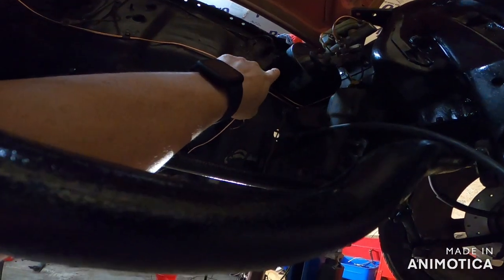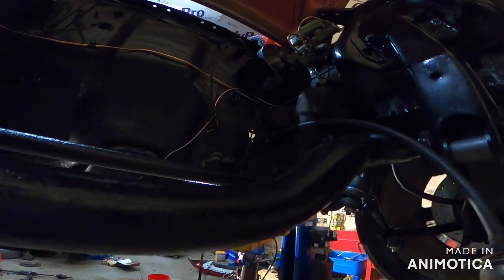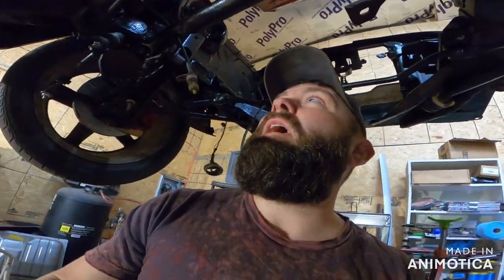I really want to take the time to show you guys — not only did we end up with four wheel disc brakes, but remember how I told you you might have to massage the front of that? Plenty of room. You don't have to massage anything, grind anything, or do any kind of extra work except for that plate on the firewall from the '94 — or make your own template. I did that, and it all fit beautifully. I want to recommend this nickel-copper line — that's what it's called. It's easy to work with and it bent so well. I followed the factory brake lines really easily with it.